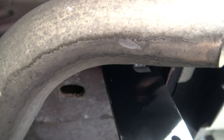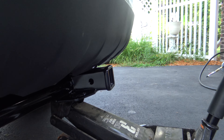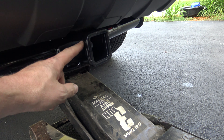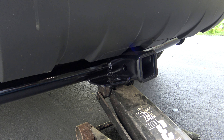I'm pretty close to where I need to be — I just want to check the other side before I raise it up all the way. Here's another tip: it's easiest to put the two bolts in right down here by your hitch mount first, rather than doing the sides. Start from the center, and then do the sides.